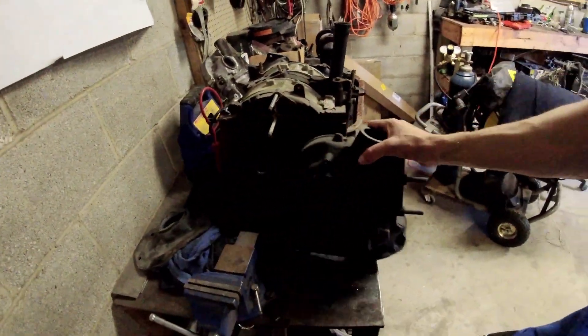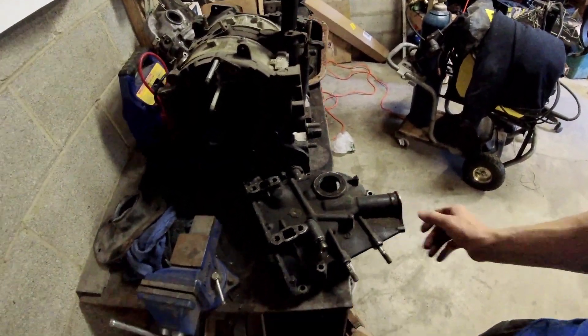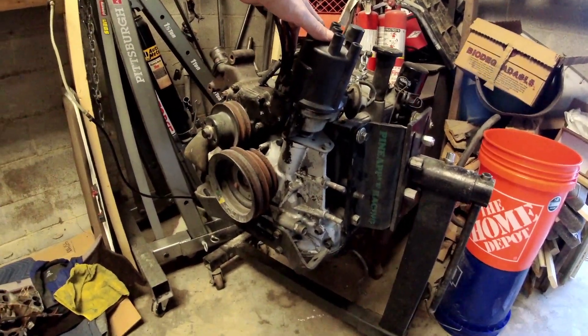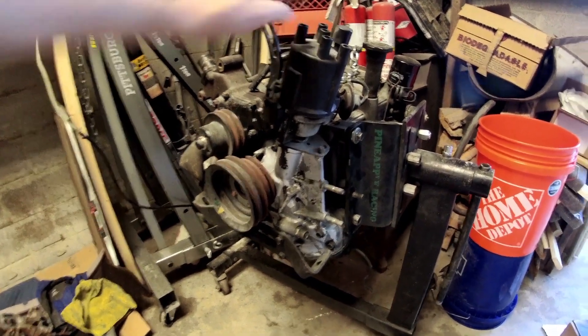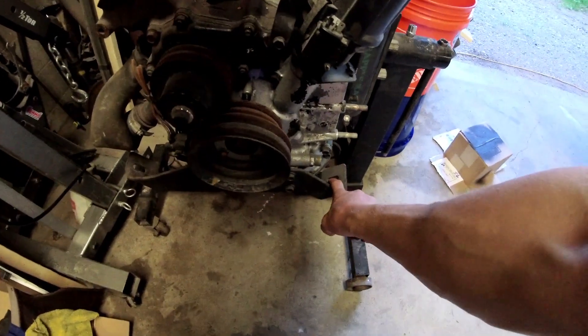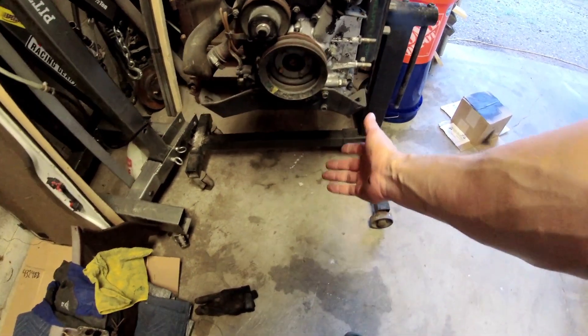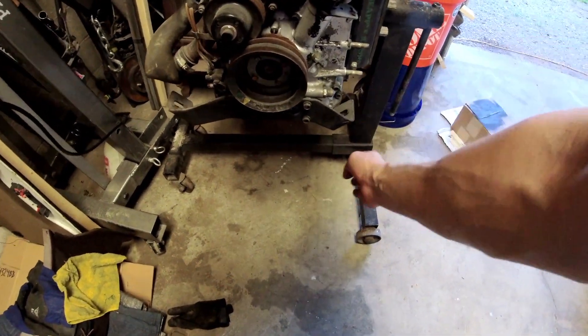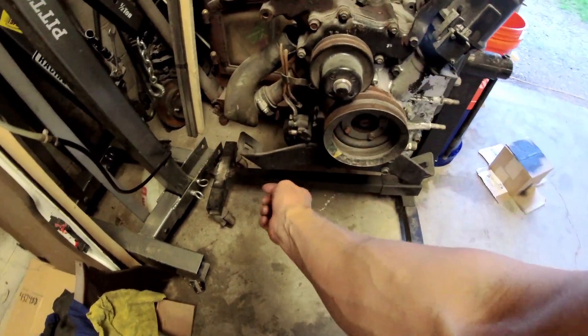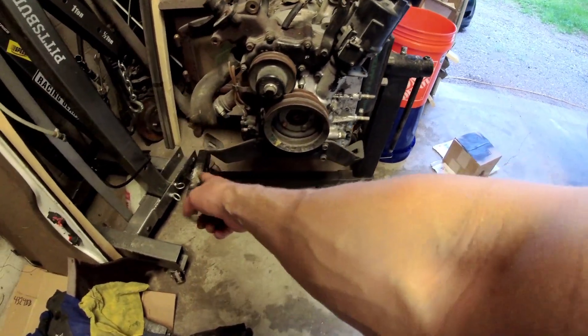So: rear iron for FD engine mounts, center iron for FC engine mounts. On an old school engine, the engine mount is on the front cover — there are four bolts on the front, and an engine bar that goes across. On FC and FD engines, the FD engine mounts are pretty much symmetrical as far as how far they stick off the engine. On an FC, the passenger engine mount sticks off farther than the driver engine mount, so it's off-center.